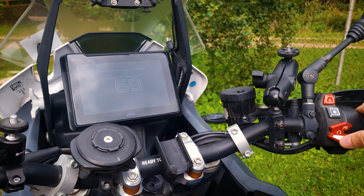It's the starter relay connector. The relay works fine, but the contacts are corroded. Somehow moisture must have gotten in here. I cleaned all the contacts. I used a contact cleaner that contains some kind of chemicals and oil. You don't have to blow it out after use.